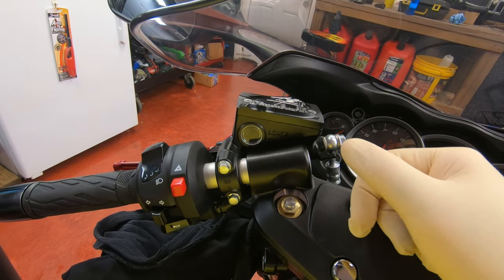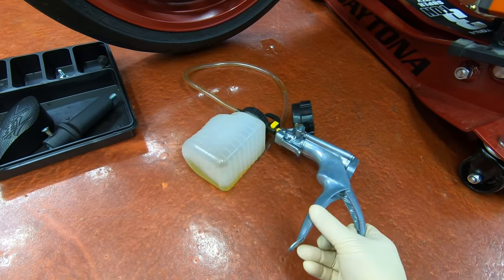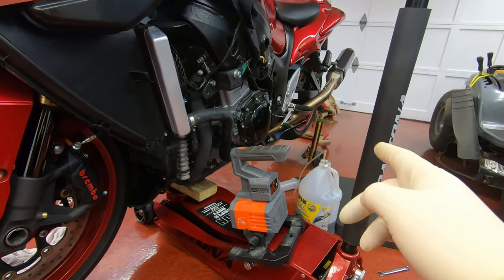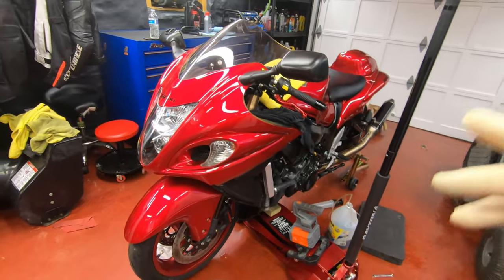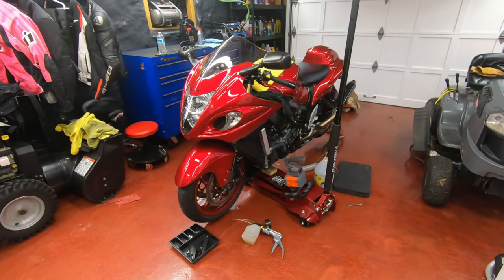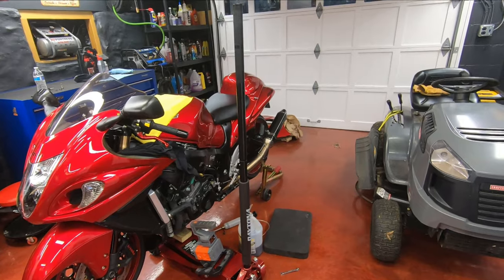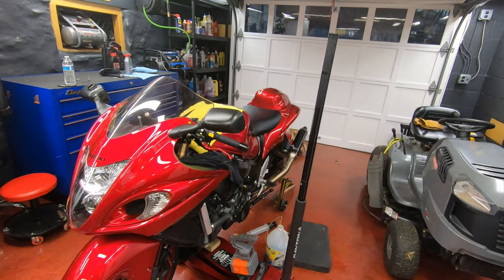A good tip: when you do the clutch or brake fluid and it's really dirty, go to those corners first and suck out the nastiest fluid with a syringe before bleeding. As for the vacuum bleeder tool, honestly the old-school method with just a tube was the best — a lot easier. All you really need is that tube and a syringe. I'll have all the links in the description. If you use those links I get a small percentage, since I'm doing everything on my own. See you in the next episode for that rear tail light!